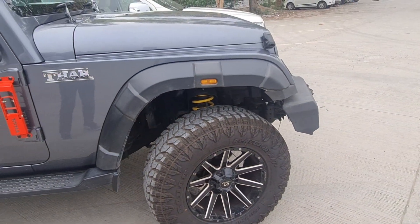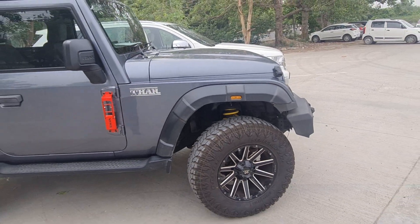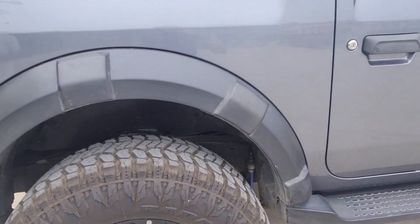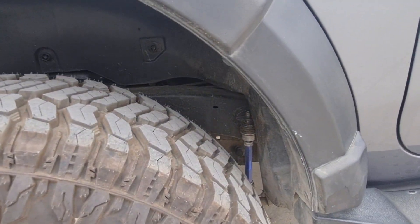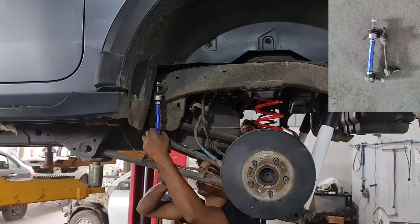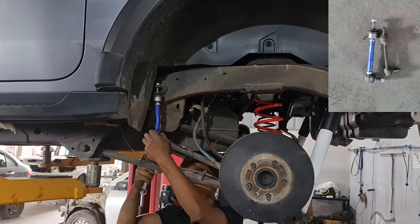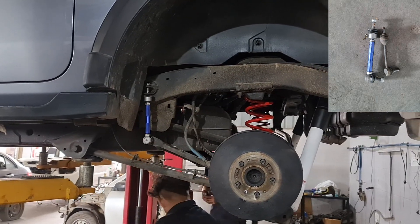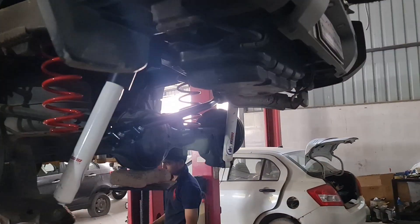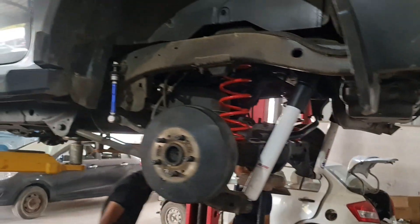Next is the link rod. The link rod is in the back of the car. The link rods have been changed — those are the ones in blue color. Previously, the smaller link rod was fitted, and the size and weight of the link rod was less. Now, considering the size of the tires, the link rods have become a little longer, so they support the rear suspension and the rear axle and bring in the correct angles.